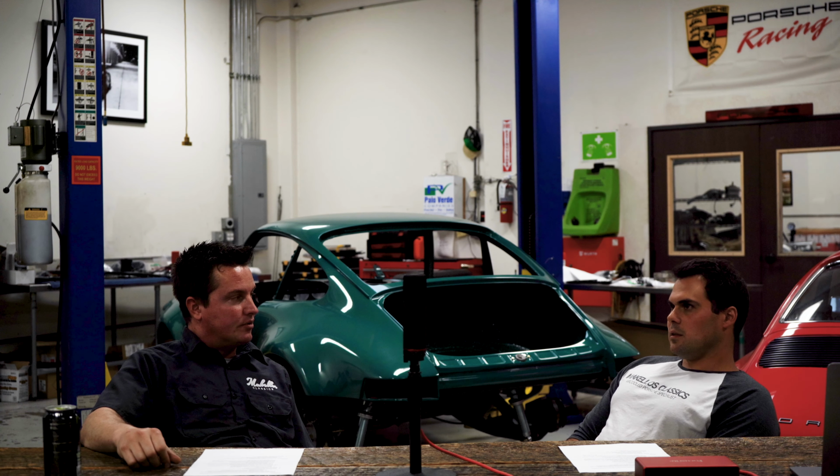But even if you wanted to go 15s, which I think we might go 15s. We're not sure yet, 15s or 16s. With boxer calipers, you can do 15s. Same with 930 turbo calipers, but the 930 turbos require a way bigger rotor. They're heavier. They will fit under a 15 if you shave the fins off. But it's about the same brake power, right? Yeah, and it's a more updated, so 930 brakes are awesome. You get better braking characteristics out of the 930 because it's going to require a larger rotor. But it's not what is really needed for this particular build.